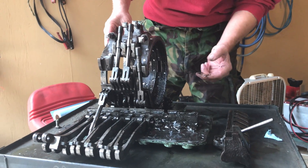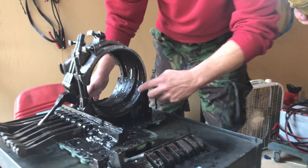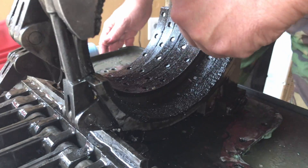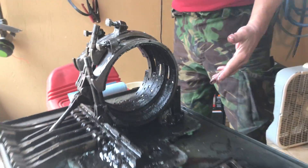What happened with this one is the first gear was chewed up. We're missing some rivets, it's been burned — this is all crystallized. You can tell the band is coming off the mount; it's been heated up, so it probably got left in first gear really bad and ran out.